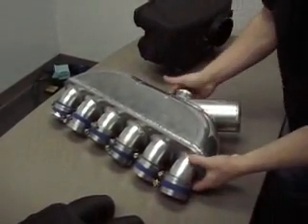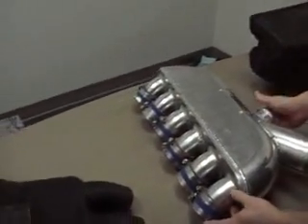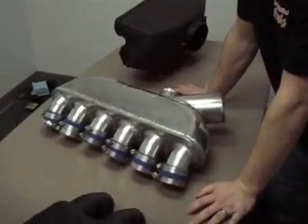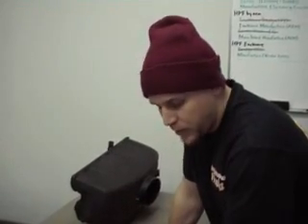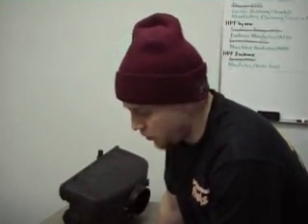The thing you'll notice right off the bat is the runner length — it's pretty short. Typically, shorter runner lengths give you more horsepower. And what we soon found out is that this engine is actually very strong; it took 670 horsepower without a problem. So horsepower isn't really a problem on this car. We decided, why not try to go for a little bit more torque?